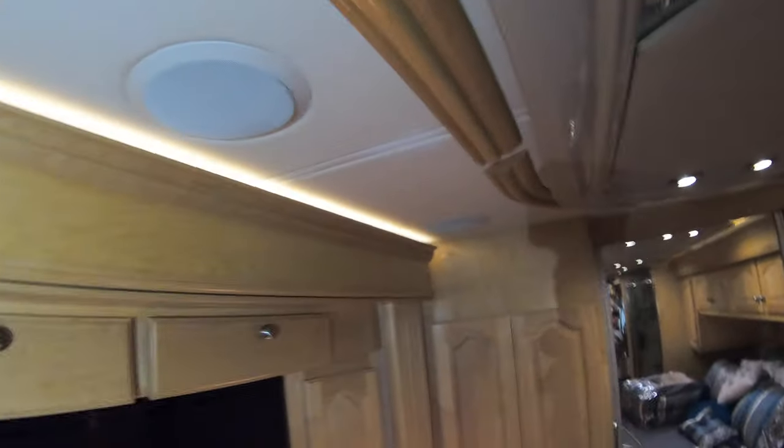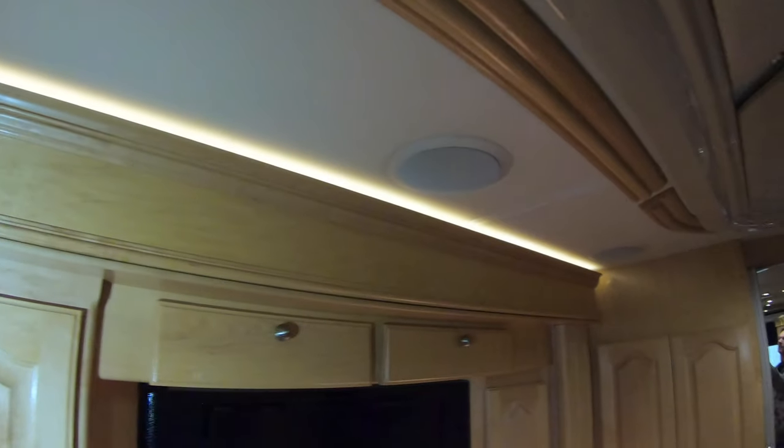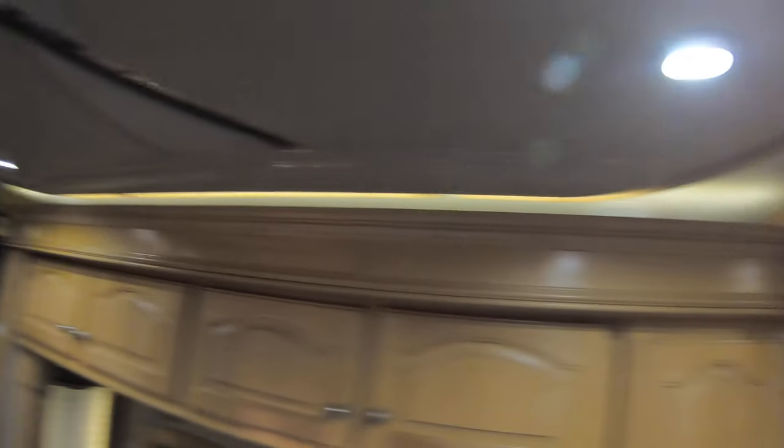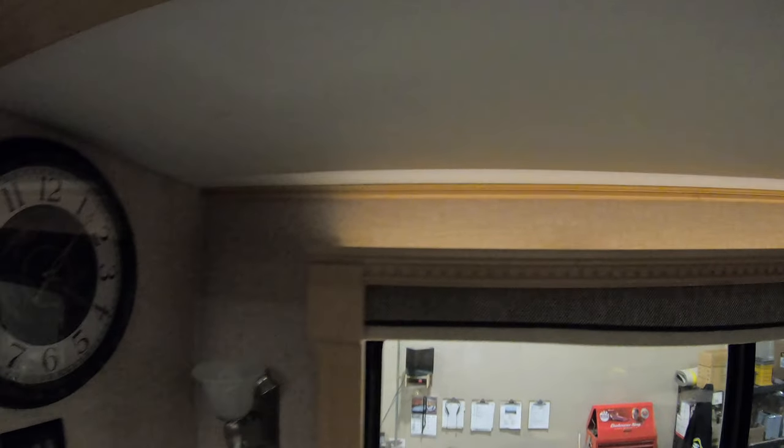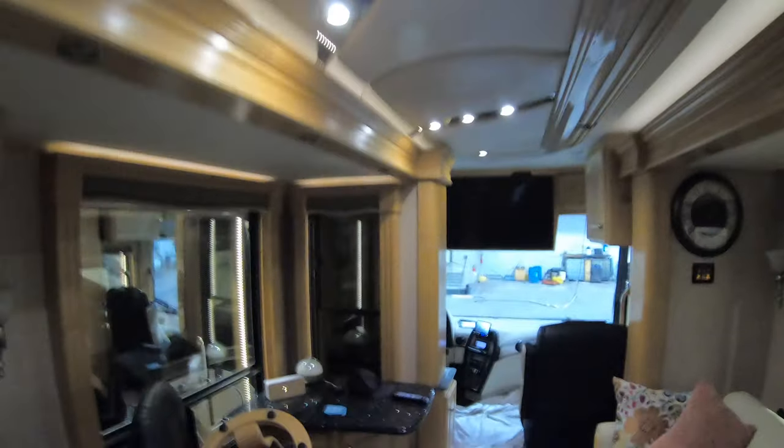To do the mood lighting in this one, this panel above here — I pop it off so I can get my lights in there. You can see we've got it down here on the floor also — you can see the pattern there with all the resistors in. You can pull the resistors out but then they're going to be really bright, and not everybody's a fan of that. If you wanted them dimmer, we can always put higher value resistors into those modules.